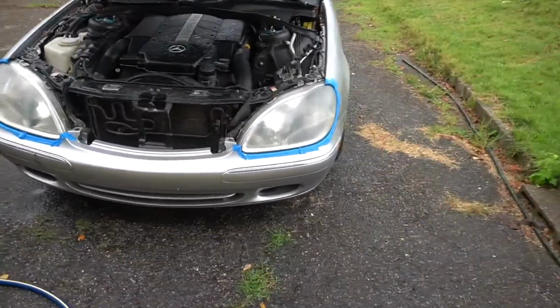I think I'm gonna try and dry it now. Dry it off with a microfiber and then hit it with the random orbital polisher. I think that's how you say it. It's a tongue twister. I have like a 3-stage polishing compound kit. It's like minor scratches, medium scratches, and heavy scratches. So I might start with the heavy one and then work my way down, and then finish with the headlight polish and then see how it looks. Let's get into it.